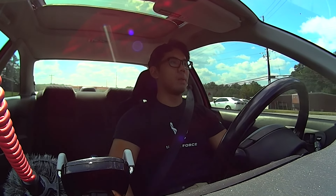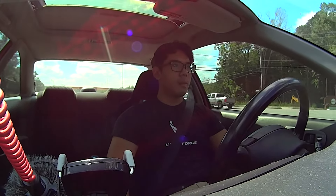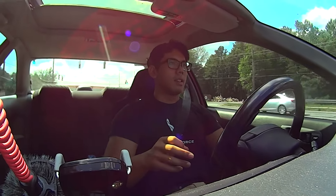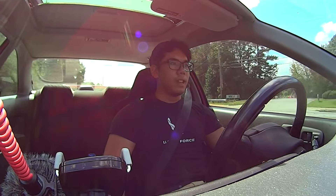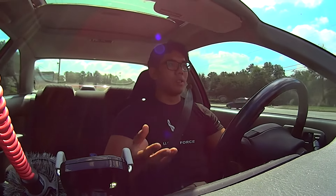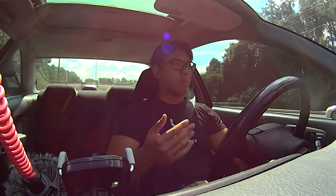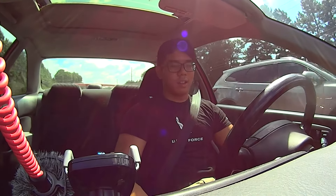It's a little bit more tedious. The install for the rear mount really took up the most time — after that the rest of the mounts were a breeze. Some guys have said they've installed everything besides the rear mount, but I think that's a terrible idea because all the movement has to go somewhere. If you stiffen all the other mounts, your rear mount will wear out much sooner. Anyway, I'm on my way to go pick up some fenders for my S2000, so I decided to take you guys along so I can feel it out and understand where I'm going with this whole mount situation.